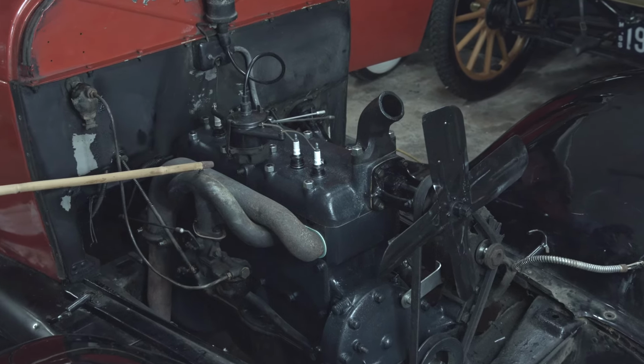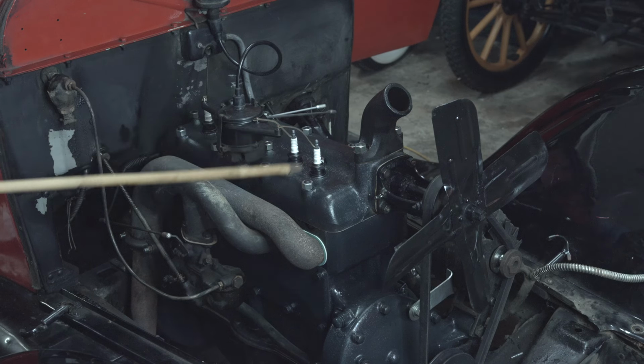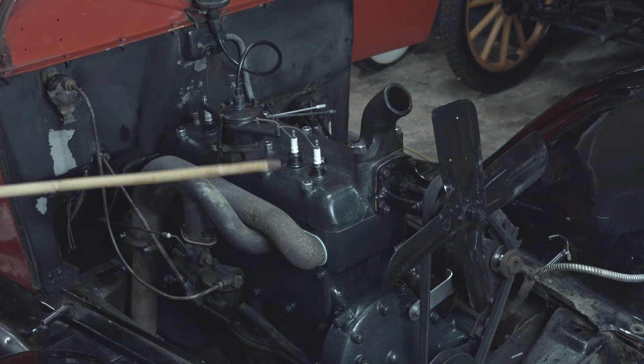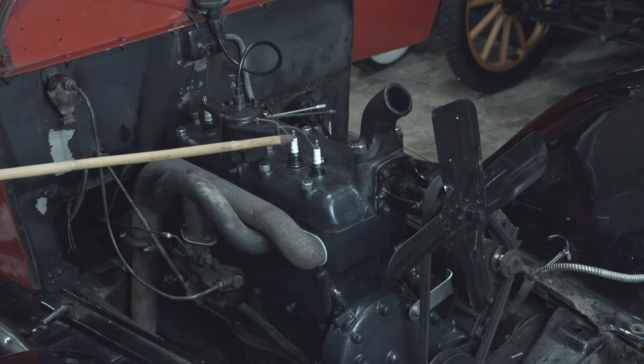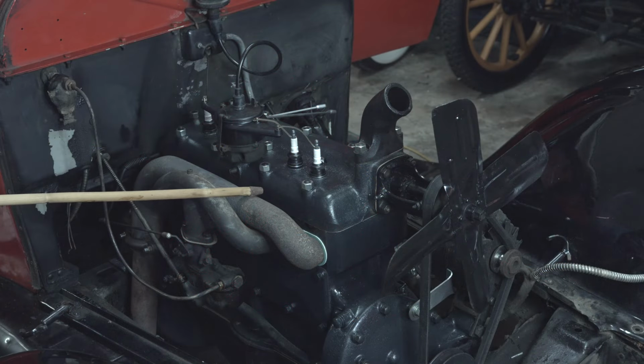And you might notice this distributor is a unique thing. It sits right in the middle of the motor, and then of course the spark plug wires are solid. They're not a wire at all. It's just a strap of brass strap. So you have no trouble. That's one of the trouble-free things about a Model A, is them straps. They don't give any trouble.